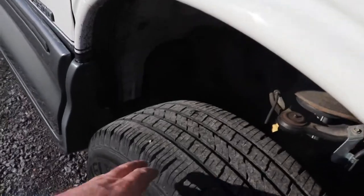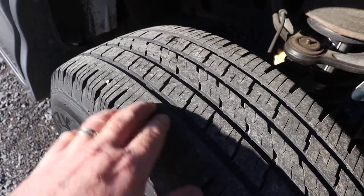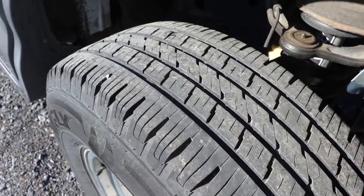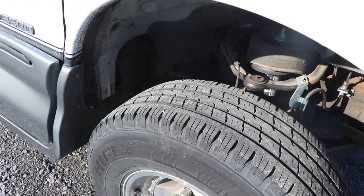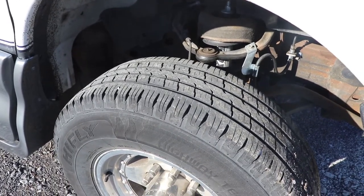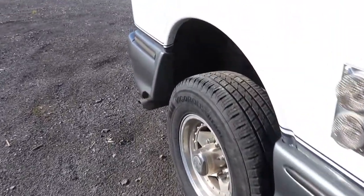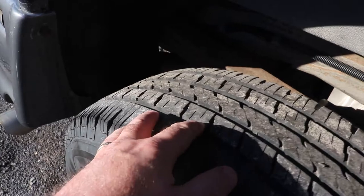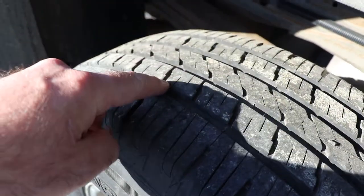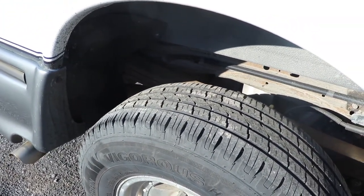You need to look at the condition of your tires. When things are working well the sipes will have a very sharp edge on them and you'll have a nice smooth pattern, which it's got currently, but it's still getting a wobble. Sometimes you can make it go away briefly just by doing a rotation, but it's not going to make it go away permanently. These were previously my front tires and the edges are kind of rounded off — I think that's a symptom and not the cause.